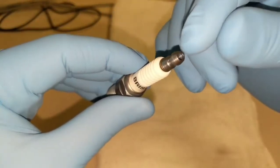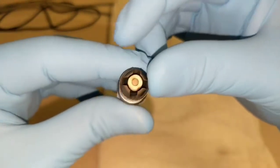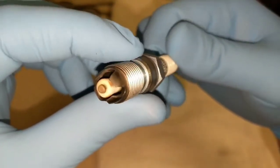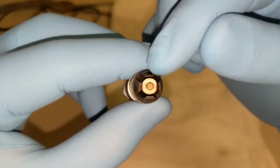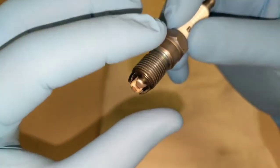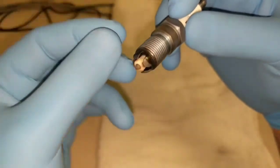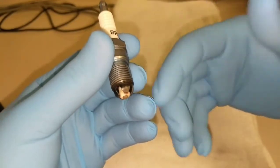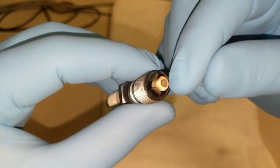With four ground straps, it's a lot less likely for you to have a misfire. And being that it's a silver conductor, you get a more powerful spark. As you can see, all four of them are seeing some spark. Some will see more obviously — this ground strap here has a darker spot. That's going to depend on the airflow and the fuel-air mixture coming into the combustion chamber. One side may favor ignition more — for example, the one pointing towards the valves might be first to ignite the flame kernel.